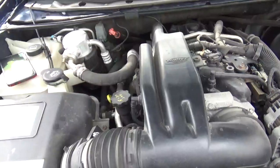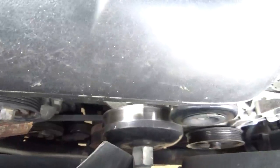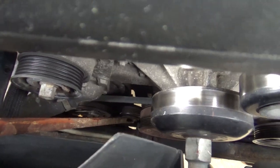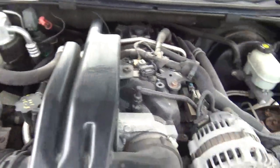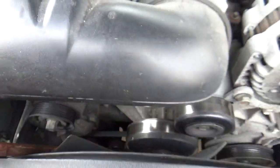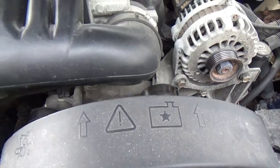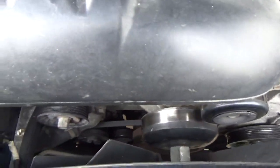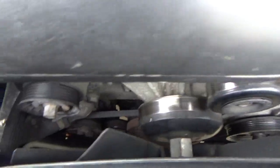I thought I'd show you what I did to check that pulley. Oh, it's the wrong way, isn't it? Yeah, there we go. As you can see, I got everything off, and then put that stick down in there, and I could listen through it when I put my ear over the top of it, and I could hear it. So I'm not going to bother changing them pulleys. If anything, I'll take them back and go get another idler pulley for that and a belt.